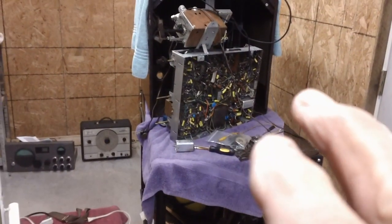Those of you who remember — we had nothing on the screen for this television, nothing. Well this is what we have now after changing out those two capacitors. It's amazing what two little tiny capacitors can do to a TV. It was just stone dead, not even a glimmer of a raster. But now I have to do an alignment on the horizontal oscillator — whenever I hook up the VCR I get those slanted lines, no matter what I do. We also replaced a couple other parts that weren't bad but I wanted fresh parts in there.